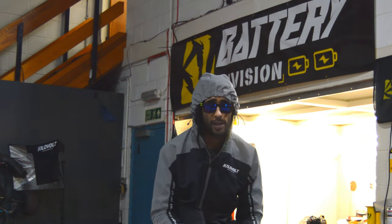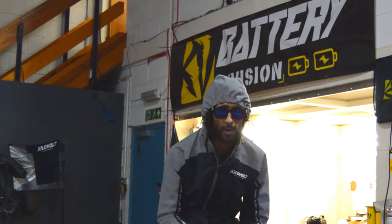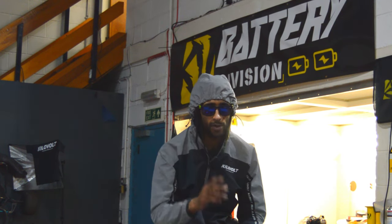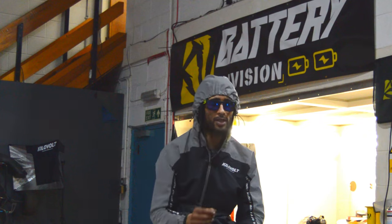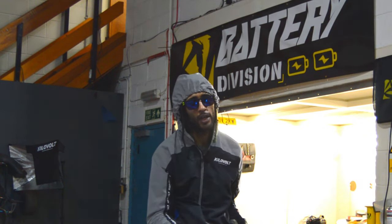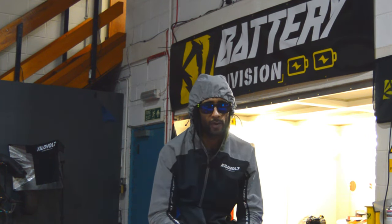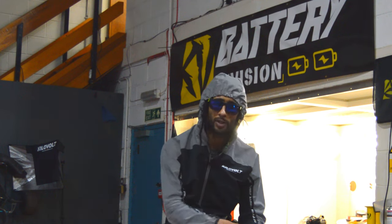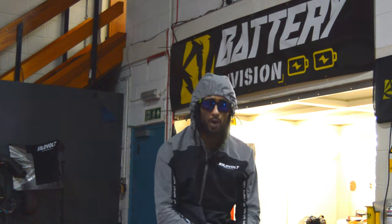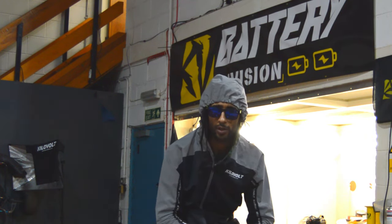What we're gonna do today is, because we're a little bit stuck for time with today's episode, we're gonna call it quits here, but we're gonna revisit this very soon, probably later on in the week, when I've had time to acquire an ASI controller. Now, the reason we're going to use an ASI controller is because the guy who masterminded the encoder to Hall sensor converter, that's what he's designed it for, and that's what he's used it with, the ASI controllers. So we'll get one of those. Hopefully it works all hunky-dory, and then we'll continue the 72-volt Talaria Sting Quest.